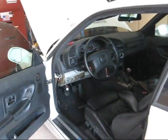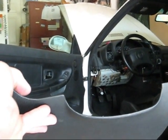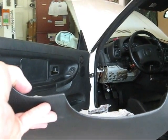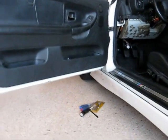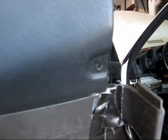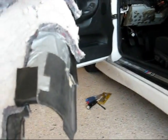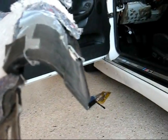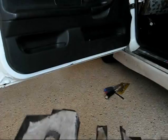I've taken out this panel which fits underneath where your knees hit — the lower instrument panel. Three screws: one there, one there, those two are up front, and then one you've got to reach down underneath where your right leg would be. So three screws. And then it has a clip there. You have to be careful fitting those slots around the brake and the clutch pedal. On this side, that little tab slides inside the console panel, so you've got to work it a little bit to get this panel in and out.